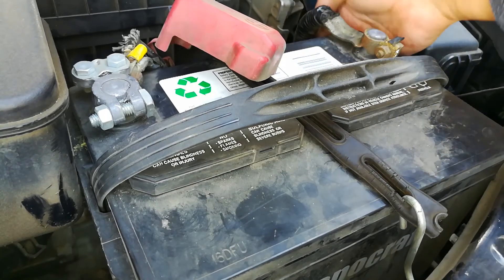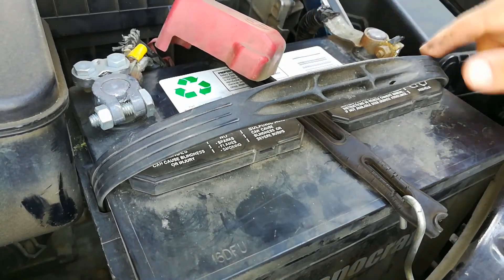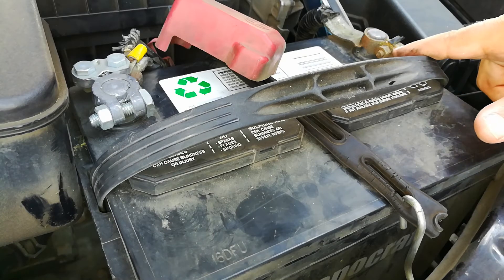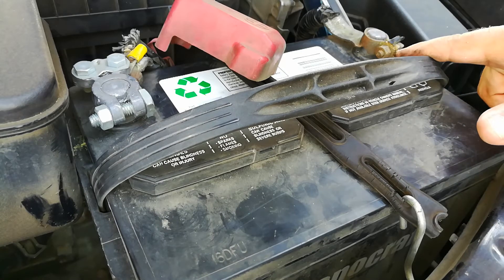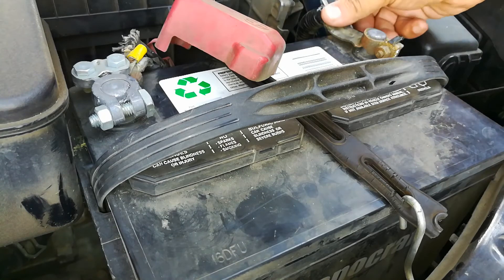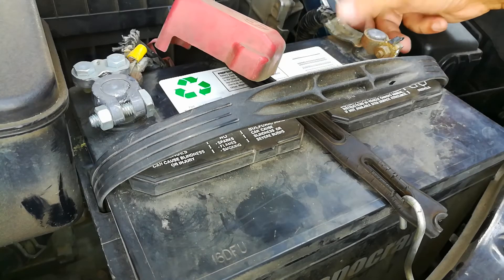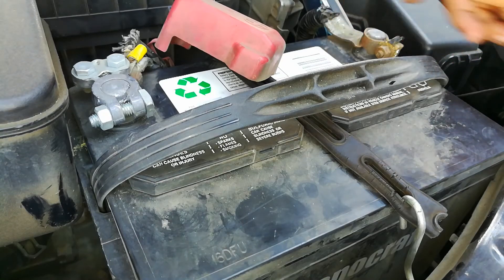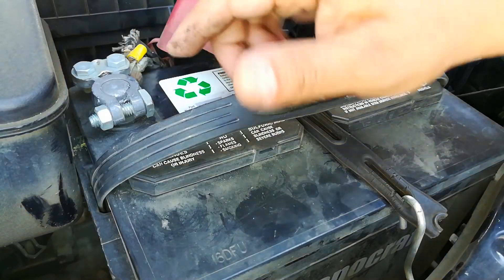It's got the correct negative terminal on here and that negative terminal is nice and tight, the wire is nice and tight, but it does have a lot of corrosion. Somebody has had an amplifier or possibly a car alarm installed in here in the past and they didn't clean it up. So if I ever have a bad crank, slow crank, or erratic starting, I would want to clean all these terminals up.